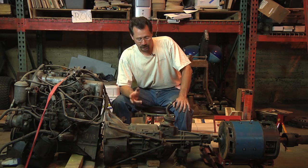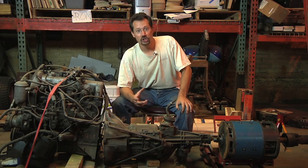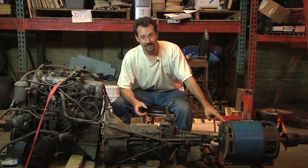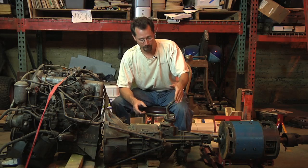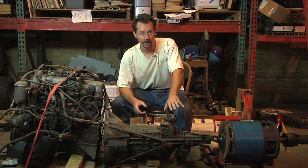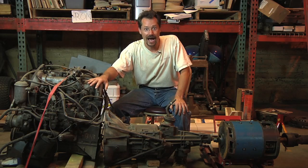So here's some of the magic. It's a manual transmission, and I've got here an 11-inch electric series-wound forklift motor. That's going to connect to the drive shaft, and it's going to do it after the transmission. So when the transmission's in neutral, I'll be able to drive the truck on just the electric motor, and I won't even need the engine to be on.